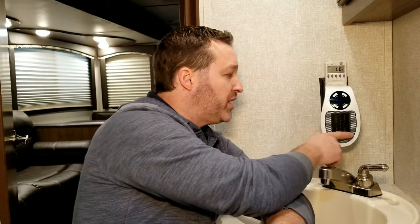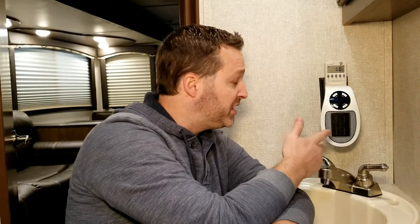For $30 I don't think you can beat it. The watt draw is only 350 watts at roughly three amps. For a nice little heater, I was surprised it took that long to actually shut off on the safety test, but it still did — so that's good. I'm not affiliated with Amazon or sponsored by the company, I don't make any money, I'm just doing this for fun and to give you guys a product I think you might like. If you like it, subscribe — until then, I'll see you next time.